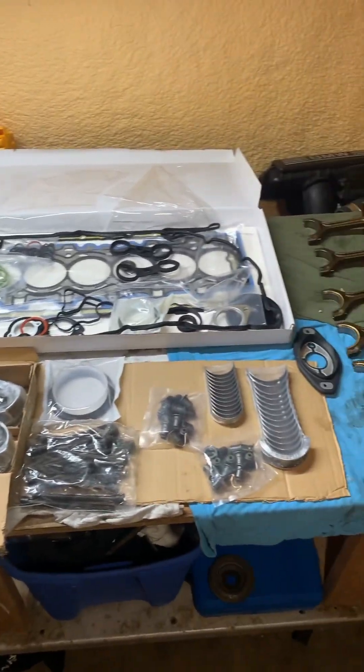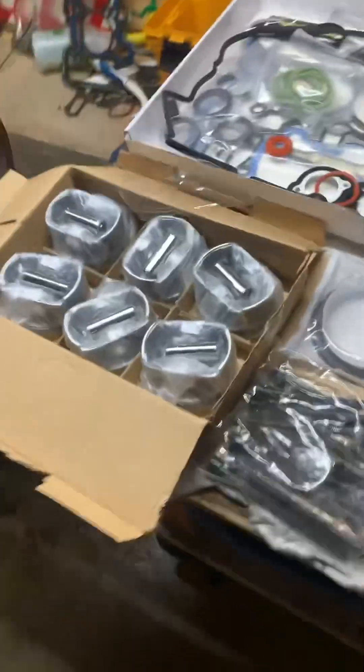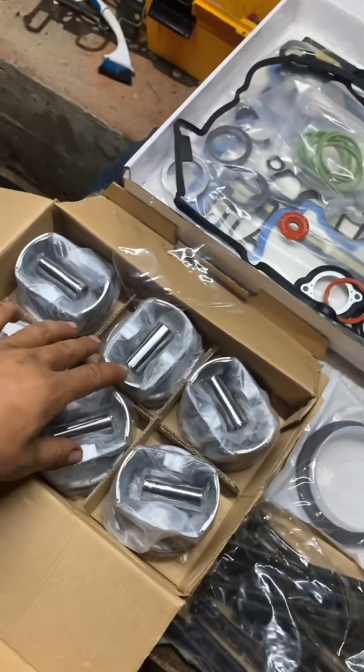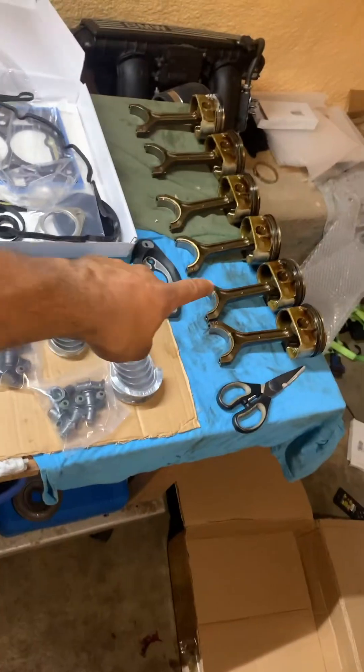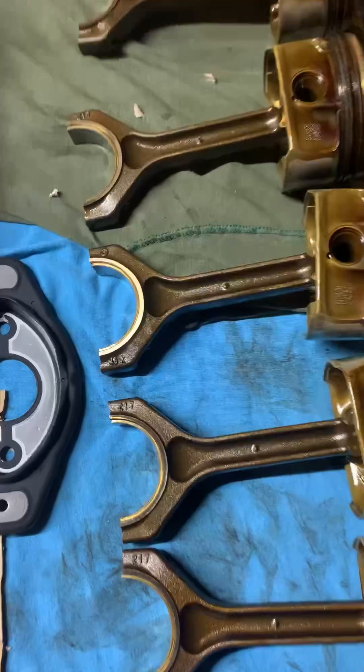All right, so here it is opened up. It's a pretty extensive kit — a full engine overhaul which has new piston heads with lower compression. The only thing you'll be reusing is the rods, so we'll actually get to see how much the stock rods can handle, because everyone has some debates on the stock rods being the next thing to go.